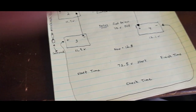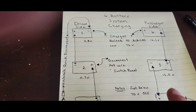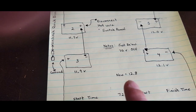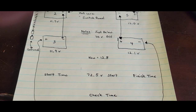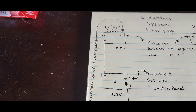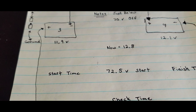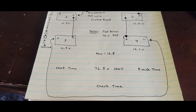The wiring runs around and up to the passenger side. I disconnect the hot wire to the switch panel. These are my notes: below 70 volts, charger off. A new battery individually runs about 12.8 volts when brand new. Right now they're reading 12.1, 12.0, 12.1 — not that low — then 11.8, 11.9, 11.9. I write down my starting time. The total series reads 72.5 volts. I check them individually and all together in series.